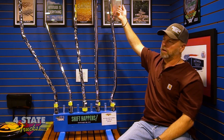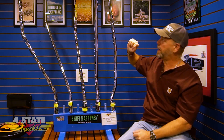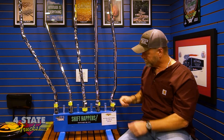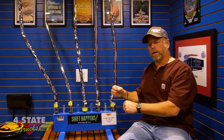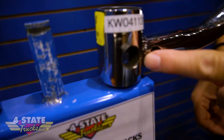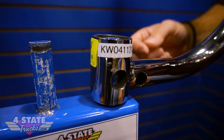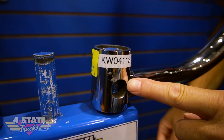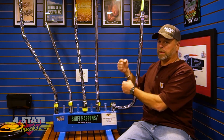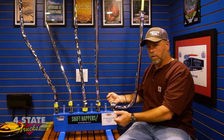Easy install — you're just going to remove the collar off your shift stick, unhook your airlines and label them so you know which port they go back to on your shift knob, then set those aside. Unscrew the shift knob, take the shift boot off the floorboard, and reach down below the floor to take the keeper off the pin that goes through your isolator — there's a rubber-encapsulated isolator there. Knock that pin out and you'll be able to take the factory shifter off.